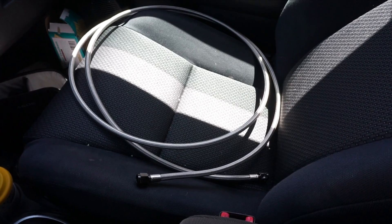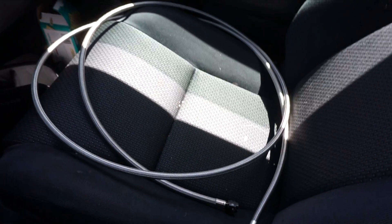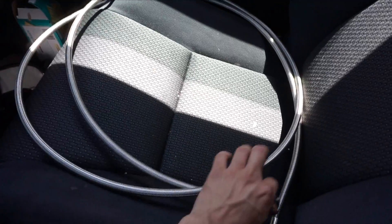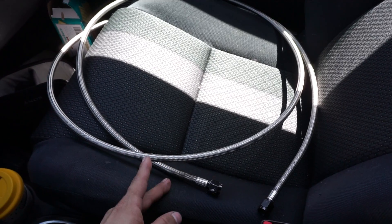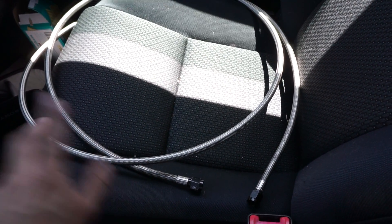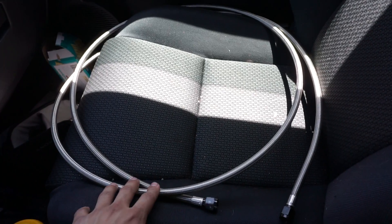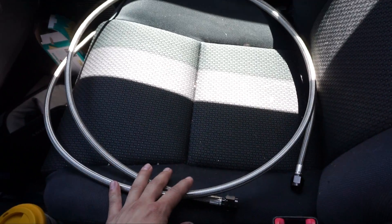Learn from my mistakes - when I was looking up how much length I need on DSM Tuners, they were saying 10 feet. I'll tell you right now, 10 feet on the 2G body is too long. So I'm back at G&J to get this line shortened. It's actually 8 feet that you need. I think people were saying 10 feet because they assumed you were buying a stainless steel line for both the feed and return, so 10 feet total is good if you're making everything, but I'm just making tank to filter.